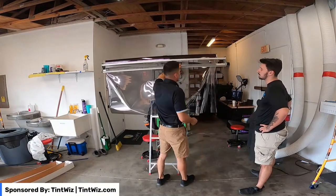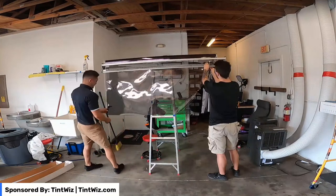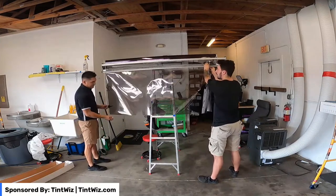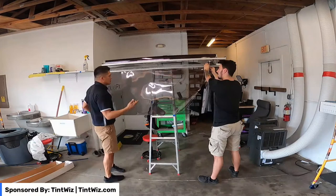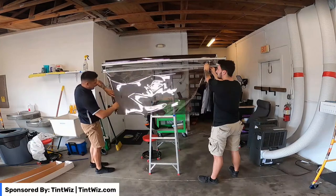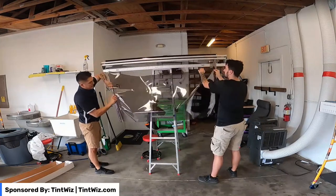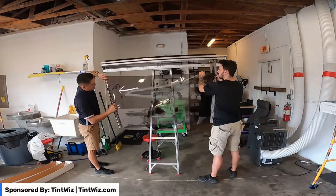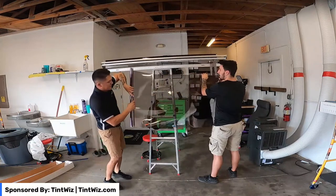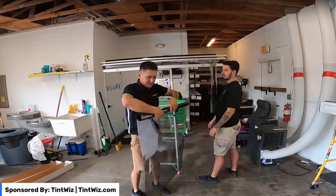Now what we're going to do is reverse roll this. I'm going to double-check which side the liner is. If you fold it over and it slides, that's liner to liner. If you fold it over and it sticks, it's film to film. So this is just like an automotive reverse roll — we're going to roll it with the liner side in. It does get a little bit of use getting used to slicing and rolling film like this, but just take your time, practice, and you'll get it. The biggest thing is not to crunch the film.